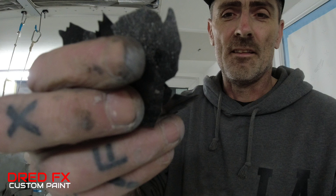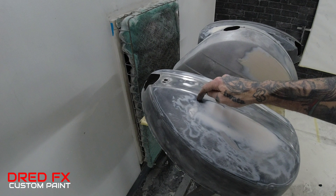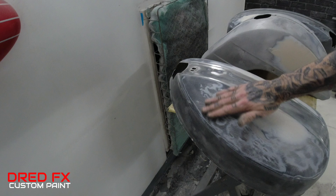Taking off sheets and sheets of paint now. This is the paint that came off — you can see how thick this is. It's just loads and loads of years of aerosols being thrown at this scooter, and you have to take it all off before you can even start to repaint or prime these things. So I peeled all that paint off the side panels, then hit them in 80 grit and went back to the original black. Then you've got the primer, and then it goes straight down to bare metal. So you've gone to the original, and then you have all the dodgy filler work this thing's had in its life — so you start digging all that out because it's all sunk.